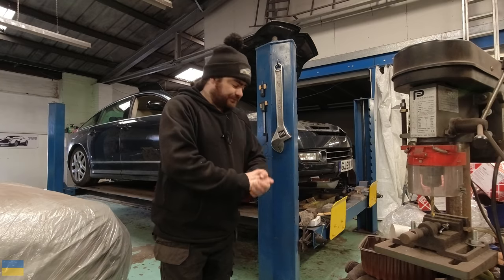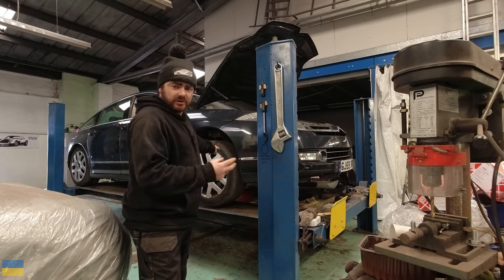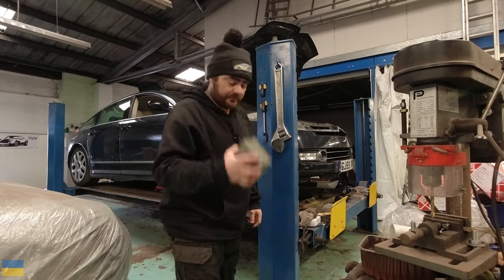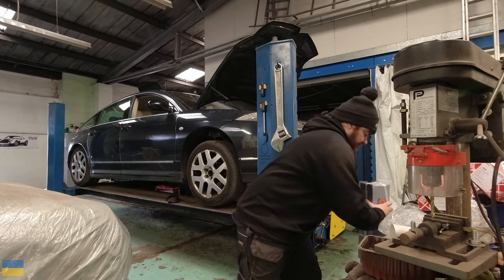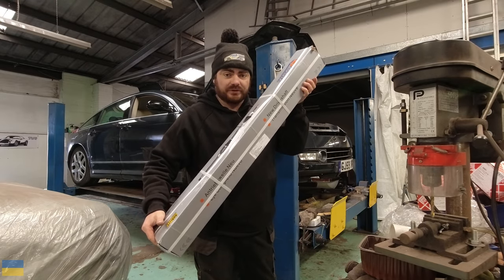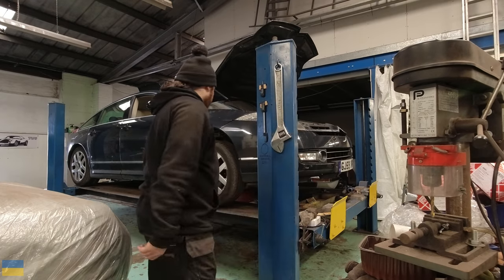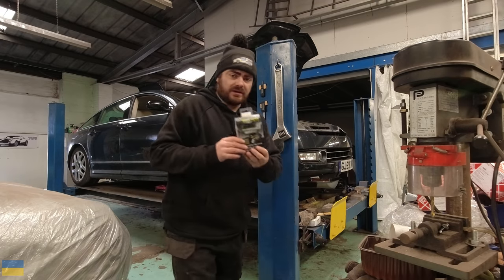There were some other issues as well. This wheel has always made a funny whirring noise with speed — you'd think that's the wheel bearing, but it might also be the CV joint. That's a very long CV joint and I know you can't buy them on their own, so it's an entire driveshaft. I also have some bushes.